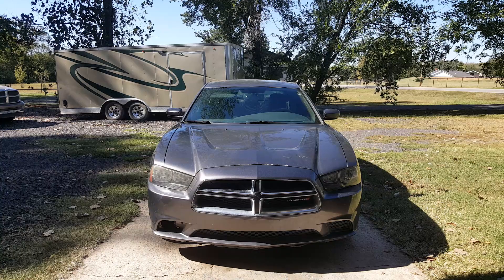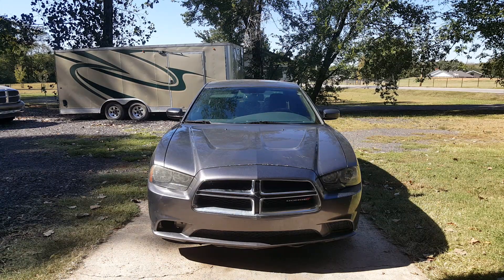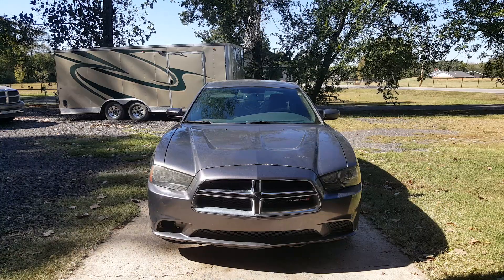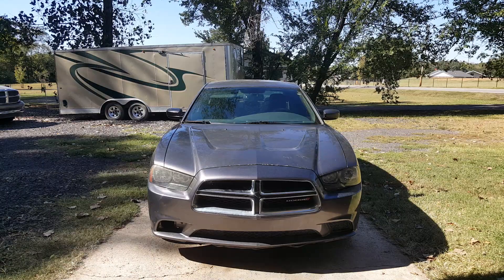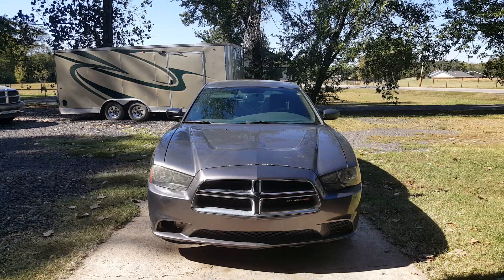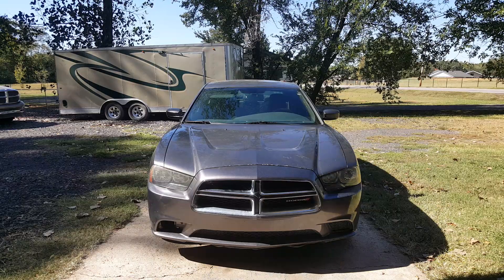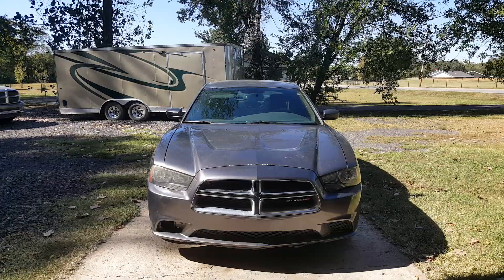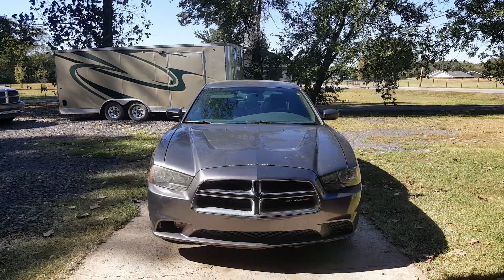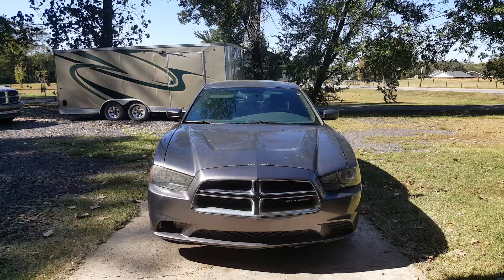I didn't even make it out of my driveway before some of the clunking noises came immediately back. Did it solve all of the noises completely? No. It helped some, but I can tell there are going to be other components under here that I'm going to have to look at — ball joints and upper control arms, et cetera. Was this a waste of money? Absolutely not. These stabilizer links are completely worn out. It's a cheap place to start because a lot of times you replace these and you get rid of the noise. The bushings look fine. I'll leave links to the correct bushing and to these stabilizer links — they worked out really well, a lot like the OEM. If you like the content on the channel, please subscribe, hit the notification bell so you don't miss any videos, and thank you for watching.